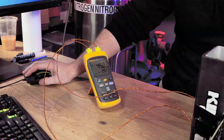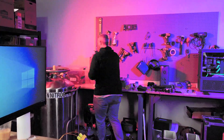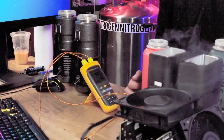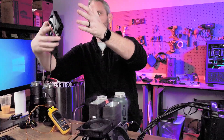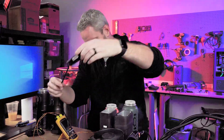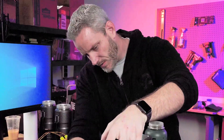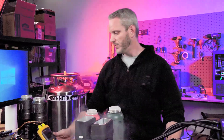Now SLI shows up after a reboot. Now I've got to fill up my thermoses and start bringing the temperatures down. One thing to keep in mind is that even with SLI, the top card is always under the most load and is going to have the most temperature. The second card doesn't go under as much load — it will obviously have a lot of temperature because of the frequencies we'll be pushing — however, it's the first card that is our most concern. I've never poured two cards before. This is going to be interesting.